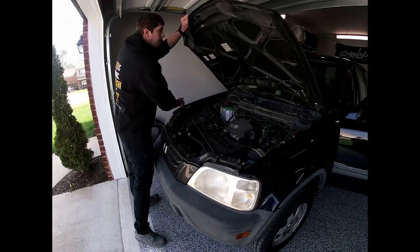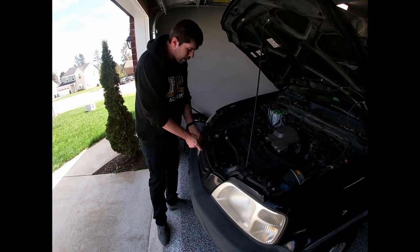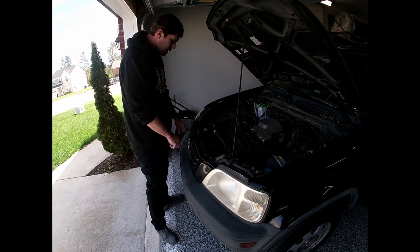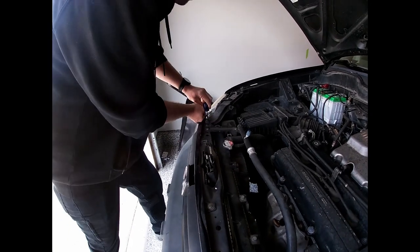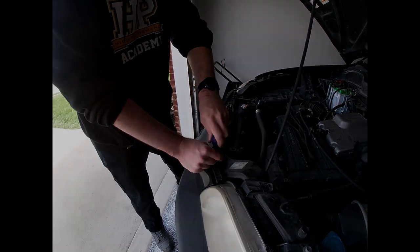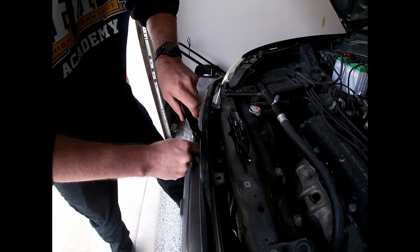First we'll start — we're going to have to open the hood. In order to access the fender area, we're going to have to take off a few things. First you're going to have to take off the center grill. It uses a flat head screwdriver here to pop it off, and then you'll have five Phillips head screws. Here I'm removing the front grill. You'll want to use a longer than stubby Phillips screwdriver in order to remove the center screw, but the other four will come out with a stubby.